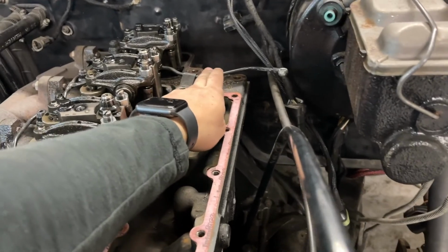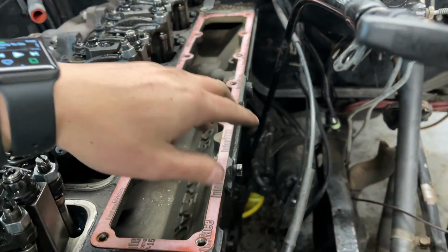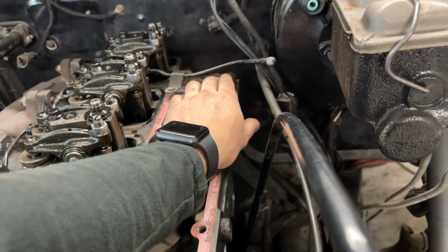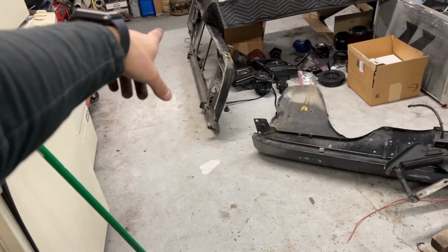And hopefully my FAST shows up this week, so then that way I can order all the fittings. I don't want to order all the fittings quite yet, just so I can do one more order, because the main thing that's holding me up is the FAST comes with an injector return T. Well, all my fittings are AN line, so I'm trying to wait till this shows up so I know what NPT thread this is, so that I can get my AN adapters ordered, and then I can get everything else ordered for the fuel system, all the return line stuff, the ANs for the breather out to the catch can, which will be right here on the firewall.